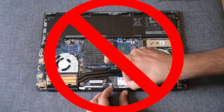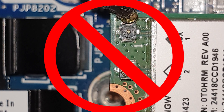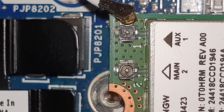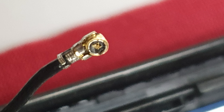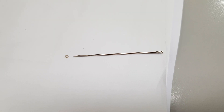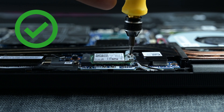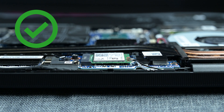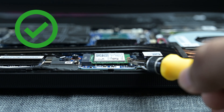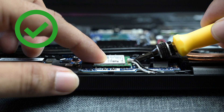Better not to use your bare hands for removing those tiny RF antenna wires, otherwise you may end up damaging the antenna wires like me. I felt the soldering of those UFL connectors is not very strong, and while removing one, the barrel portion of the connector got stuck in the female socket of the antenna wire. I was lucky enough to remove those parts with the help of a needle. Use a flathead screwdriver instead — place it beneath the connector and rotate either clockwise or anticlockwise. Take your time and do this very slowly without damaging the connectors.